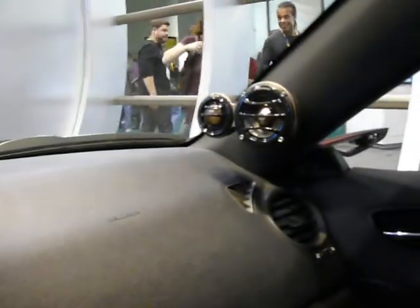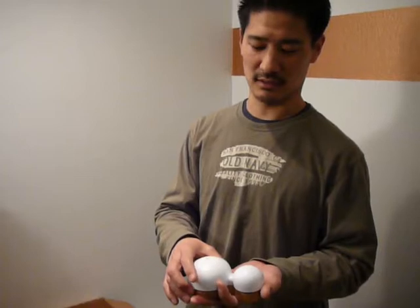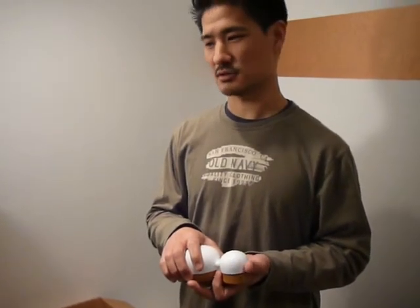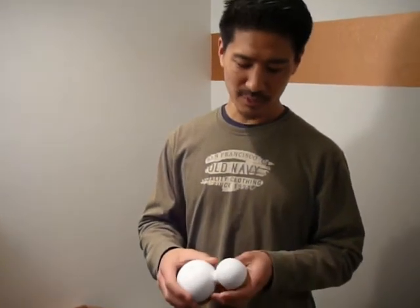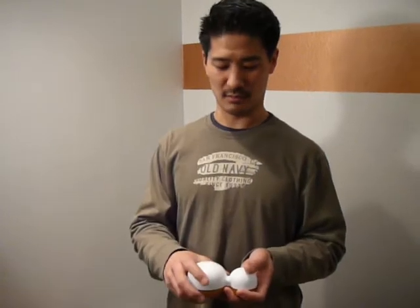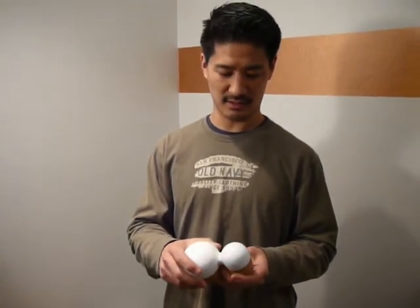And so similar to the styrene trim pieces in the trunk, I created a housing using styrene, because styrene is probably one of the most pliable materials when it comes to vacuum forming. But I use a thicker material, about 1/8 inch thick, so that you have enough rigidity after the vacuum forming process that the speaker housing wouldn't resonate. Pulled these molds off pretty easily.